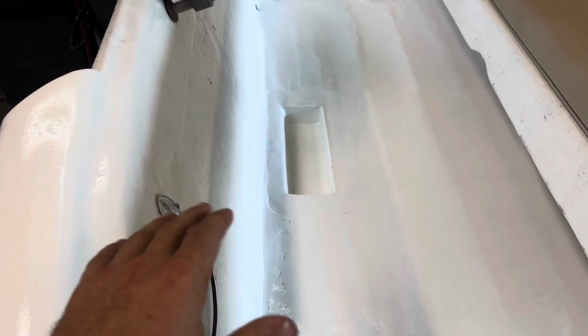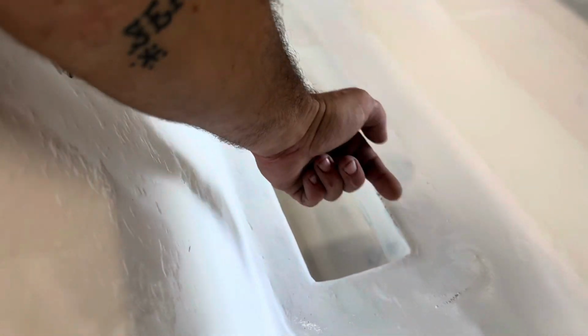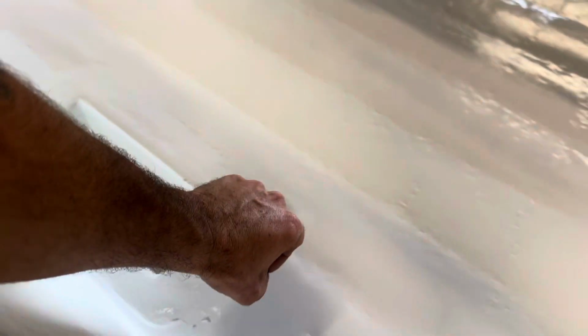Part of me wishes that I had made it just a little bit bigger, but so long as I can get an 800 gallon per hour pump right here on the starboard side with the pump facing outward, we can run it out and up, out the starboard side of the hull, and then have the float switch pointing out towards the port side.